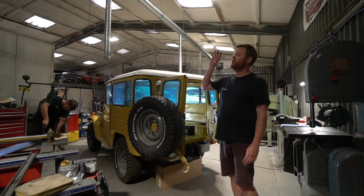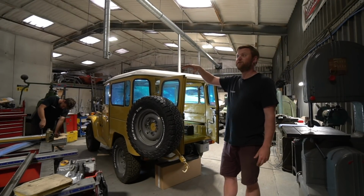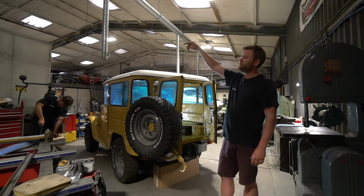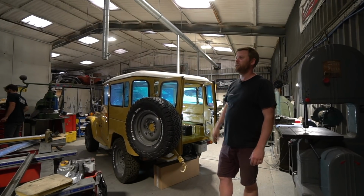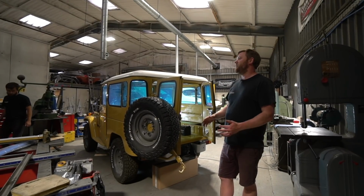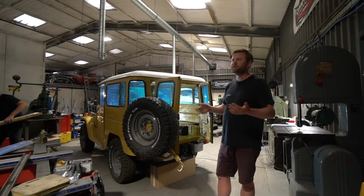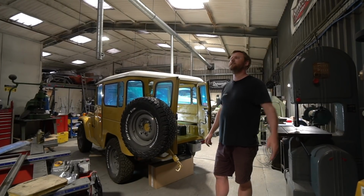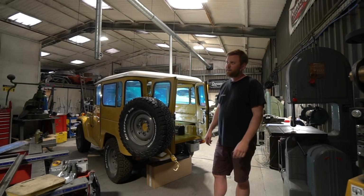one of which is to move the paint booth from in the metal workshop, which is obviously a daft place for it, but when we started out this was our only workshop, through into the paint shop. Now we're going to get rid of this paint booth and we're having a new one put in the paint shop, but then because of the extension of everything we're having to improve some of the services, so we're putting all new air mains in, we're moving the compressor to a different location to keep the runs of pipes more sensible to the different areas of the workshop.